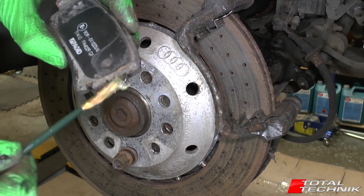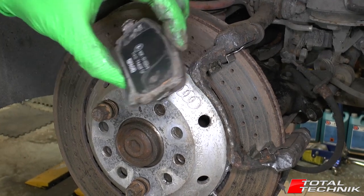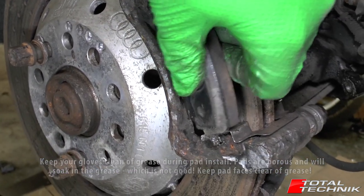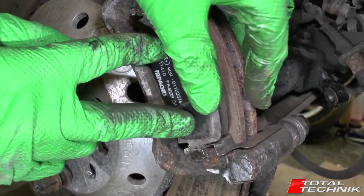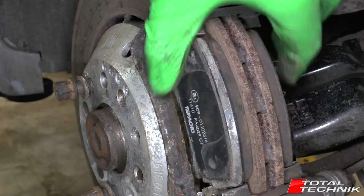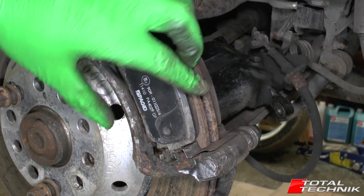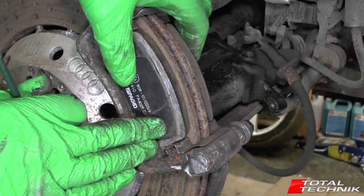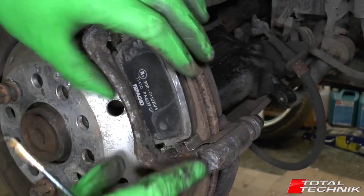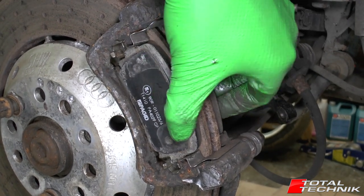I'm going to put a little bit more grease just onto the tips of the pad ears before I refit these. The ones on the front tend to be a little bit harder to fit; the ones on the rear at a bit of an angle — just feed them in until they sit flush with the disc. When you do that, because you've lubricated them, they should go in and out fairly freely. Give them a check, make sure they are moving freely backwards and forwards, and then we're ready to reattach the caliper.